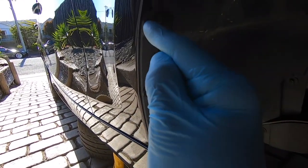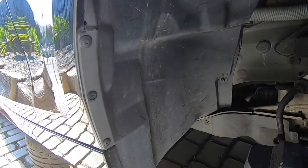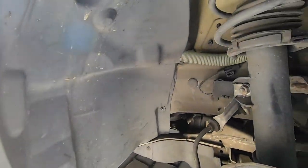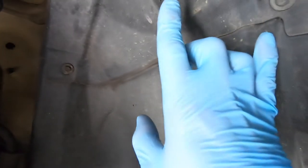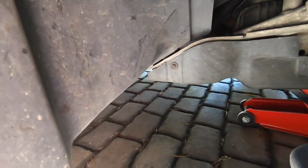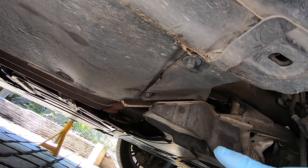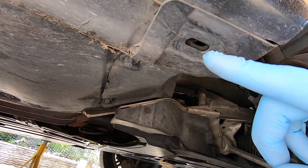The original plastic pins are a little plastic plug with a pin down the centre — push the pin right through, let it drop down, and pull them out. Once you've got the plastic pins removed, there are a few nuts and screws to remove. There's a screw up here that takes an 8mm socket, two more that take an 8mm socket, and another 8mm screw at the back. There's a nut down here that takes a 10mm socket, and two more underneath that also take a 10mm socket. You'll also find a plastic screw here that takes a T30 Torx bit.